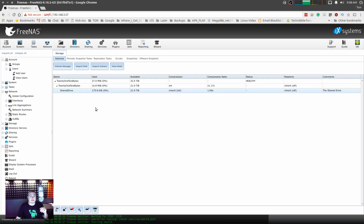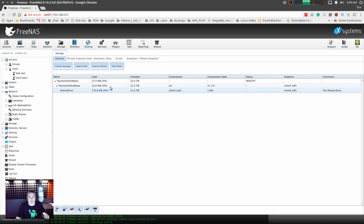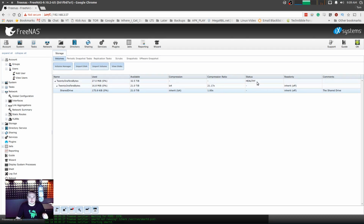So we dumped about 4 terabytes of data over to this drive, destroyed it, as in detached the array and reset it, then went and did it again. And did it again. So since we built it, it's now been through a couple of load tests. And there was an error here. We think we had a SATA cable loose. We unplugged it, plugged it back in, and the error went away. I did do some research, and someone else had pointed out an error with these drives, but it's an error a day. It was one CRC error. But we still keep an eye on everything to make sure it works. All the disks still show healthy and no issues at all.